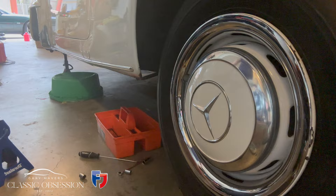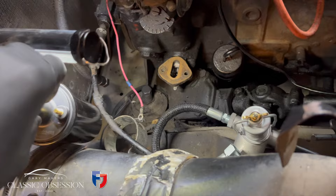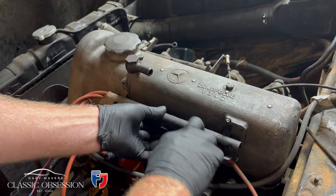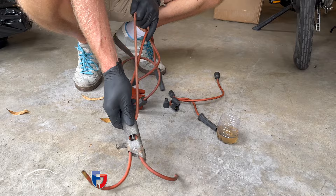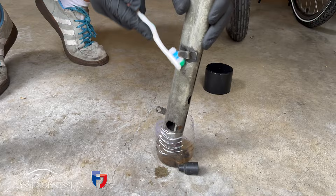Now, I know when going through the ignition system I said it would be the starter motor, but with a car that's been off the road for such a long time, I just think it's best to replace everything for peace of mind. A new coil is fitted. As luck would have it, I was able to acquire a brand new set of original ignition leads — so not only will it be right, but it'll look correct. Typical for these early Benzes, everything was designed for a reason. This tube was to keep the ignition leads separate to prevent intermittent sparking and misfire.